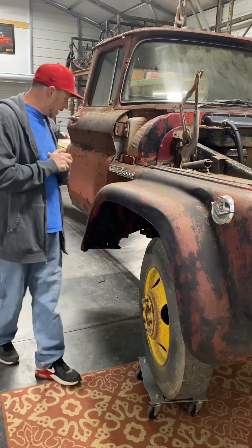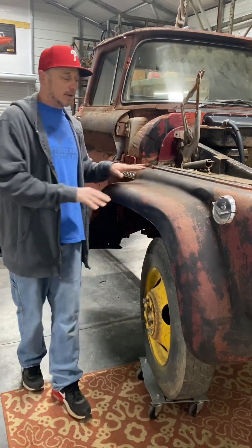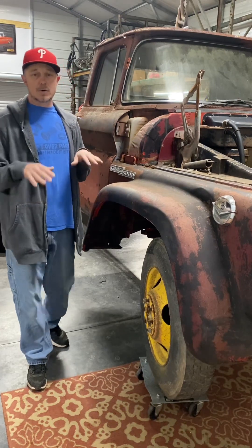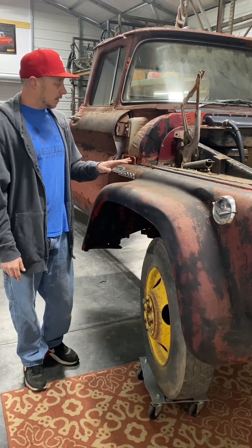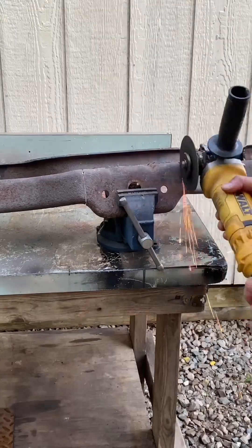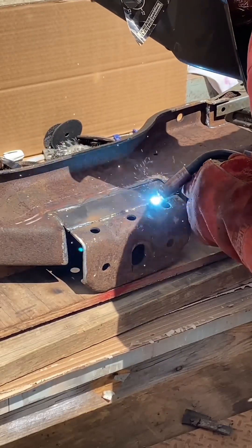Right now one of the things we've done is we've got the sheet metal off and on this frame, but we still need to position it to get our cab mounts in place. The cab mounts are in place, the sheet metal is kind of heavy on the front, so we need to get some of this weight off the front — down to basically the fenders, the core, and the cab. This will allow us to get a parallel line to the ground so we've got a straight truck. A big holdup has been getting the front sheet metal as low as possible, which took some conversion and modification to the factory cross member to get that front end as low as possible without notching the frame rails.